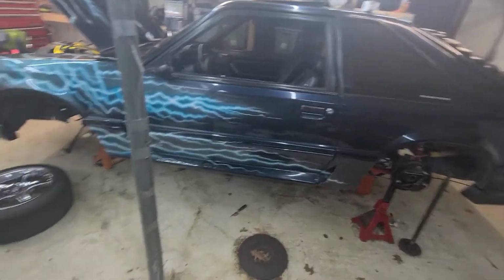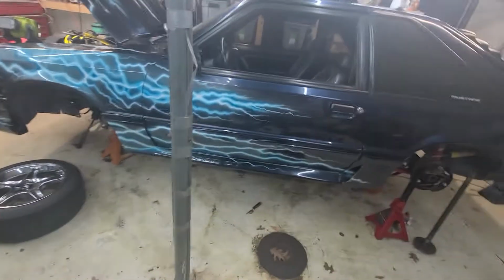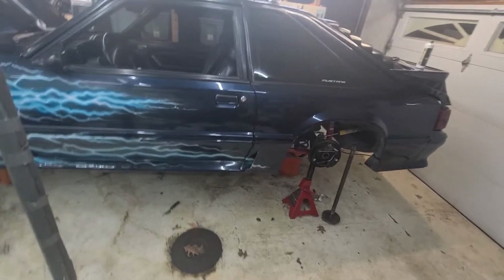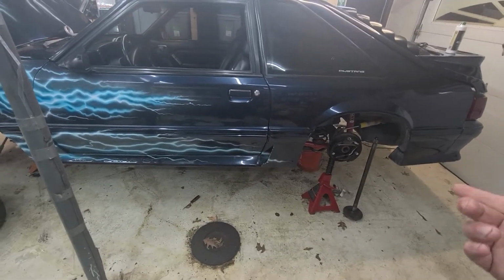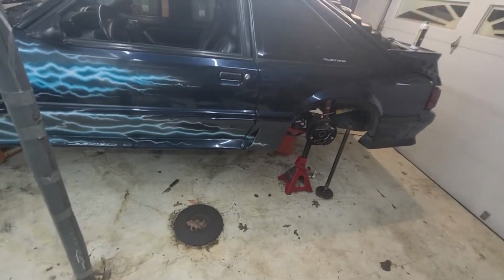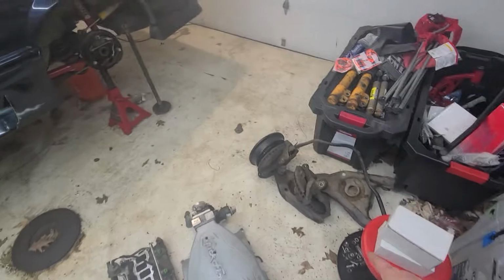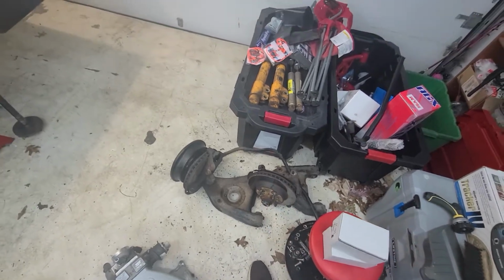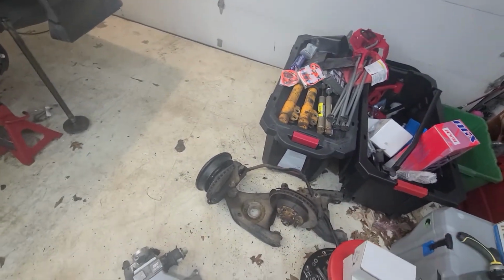First thing is, couldn't find any wheels I liked in 4x108. So I went ahead and ordered the LMR 5-lug swap. And then I realized their $400 5-lug swap is only good for certain wheels because it keeps that length on the spindle, so it pops out the caps on the normal wheels.